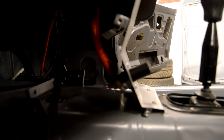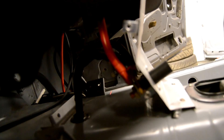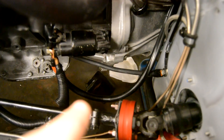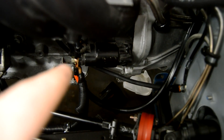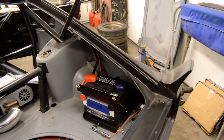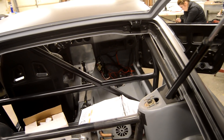Behind that kill switch here that utilizes the key, you can see that black wire — that's actually the power to the starter. I used a factory hole in the trans tunnel here, used a rubber grommet, and also put wire loom on that wire — it exits right there and then makes its way up to the starter. This wire here would be the one we just looked at behind the dash; this wire here is the wire from the alternator; and then I have another wire here that comes from the Wiring Specialties harness. They're all converging here at the starter. Right now I actually have everything hooked up — the grounds and positives from the battery going all the way up to the cutoff switch, all tightened down — and then one side of that switch when the key's on goes to the relay box that I built, which you guys will see in the next video.